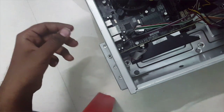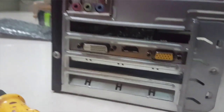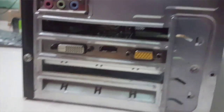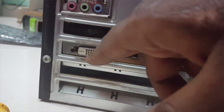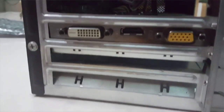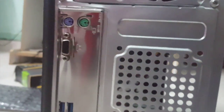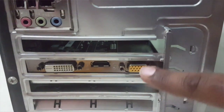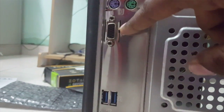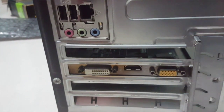It's done. I will show you how it looks from the back side — from the back side it looks like this. This is the VGA port, this is the HDMI port, and this is the DVI port. Before installing the graphic card you were supposed to insert your VGA cable here in the motherboard, but now you have to insert it here in the graphic card to take advantage of it. It is recommended to use the VGA port on the graphic card itself.